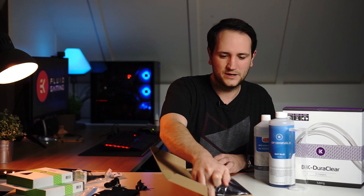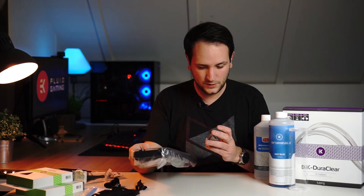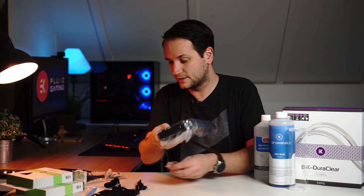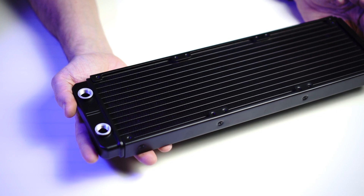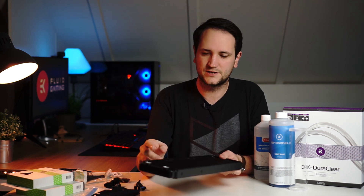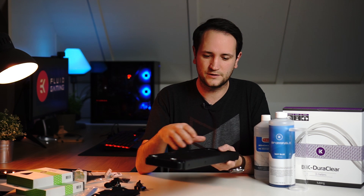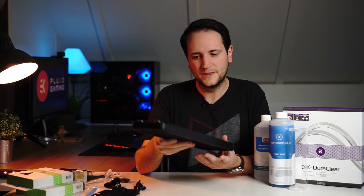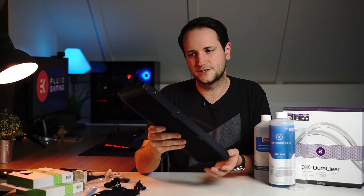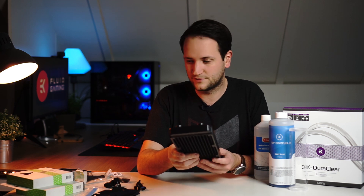The radiator isn't like the thick ones you see in high-end builds. With the kit I bought for the CPU it came with a 240 radiator instead of a 360. This time I chose the 360 because the 240 is only enough for the CPU — it needs that surface area to dissipate heat. The 360 should be enough for the Vega 64, so my system should be capable of getting rid of all the heat.